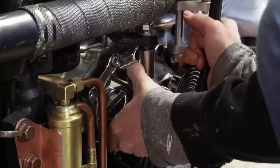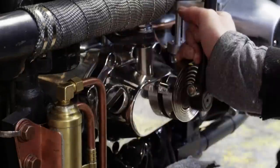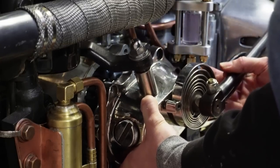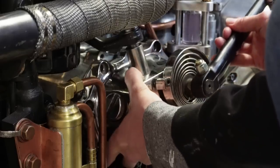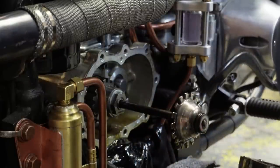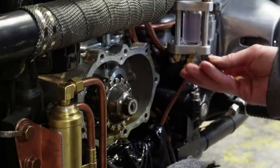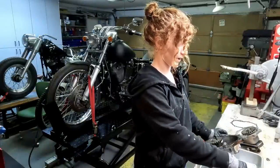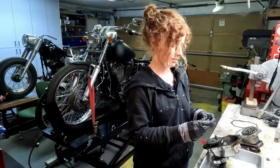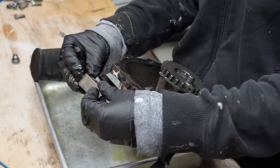Why isn't this coming off? Oh, there's still a bolt in there. I'm trying to quickly do this before all the oil spills out. Come on, get off of there now — gotta get the one gear up. There we go. Don't pull your... leave that shaft in there. So this fell out right away. Yep — told ya. I discovered what was actually broken in here. It fell right out as soon as I took the cover off, and this is what my dad told me it probably was — it's this fork in here. It's this little fork that actually pushes on the throwout bearing.